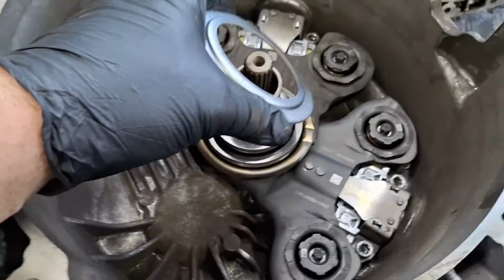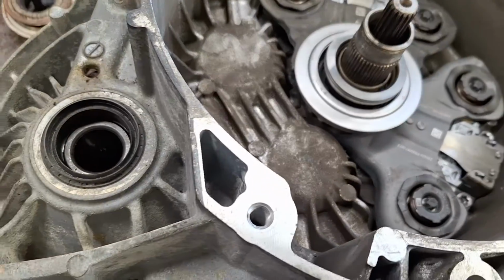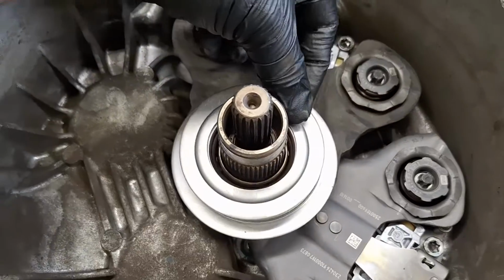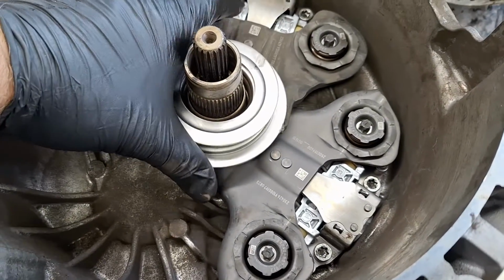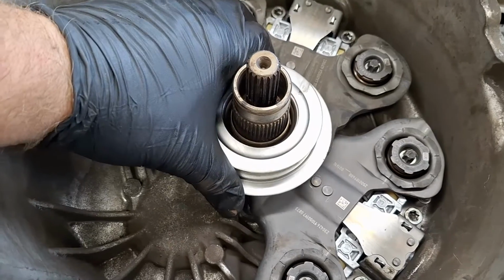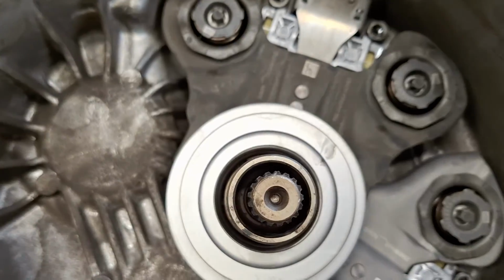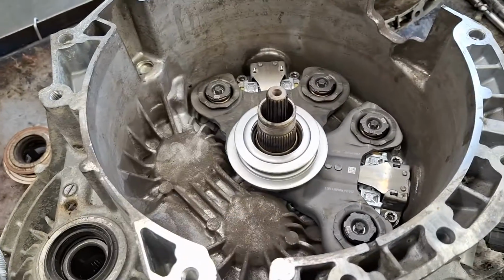Take your Z washers. Take the big one first and put it down. See, get it on that lower bearing. Take the smaller one. Get any debris off of it. Okay, and turn them and make sure they're both perfectly level. All right. Go around here. Make sure it's about centered on the top. You want to make sure it's about right before you drop the clutch in.